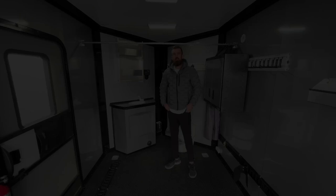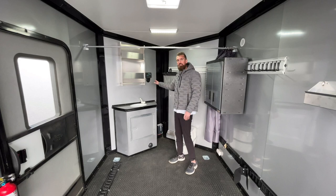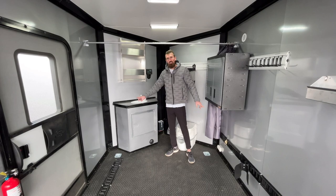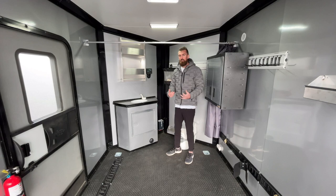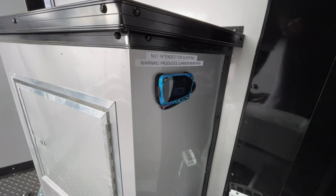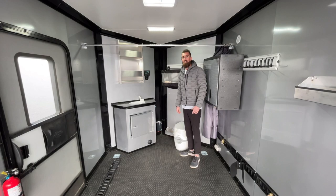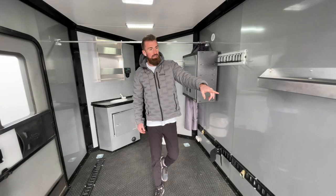Follow me inside and I'll show you what the heater looks like that we installed inside the trailer. Here we are inside. The first thing I want to show you is the diesel heater that we installed. On the front you had your tank, your battery, and everything that powers it. Inside the cabinet, we've actually installed it underneath the water tanks, and the exhaust and air intake for that heater are outside underneath the trailer. So it's dry heat, it's safe — exhausting outside and pulling fresh air from outside for its combustion. There is a digital thermostat right here on the side of the cabin that can be set to whatever temperature you like, and the heater will automatically kick on and off to maintain that temperature inside the trailer.